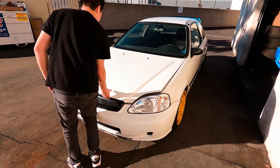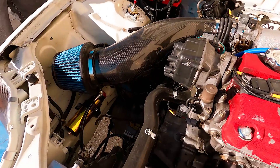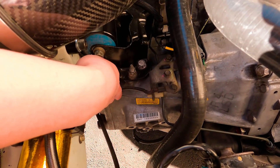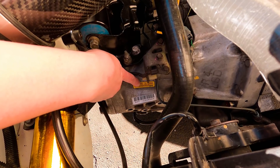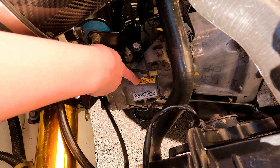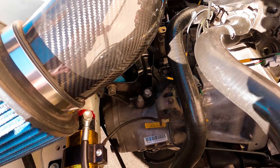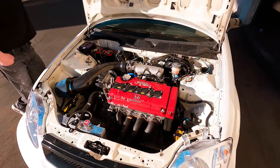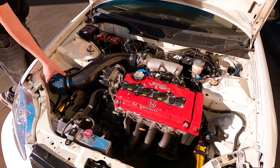They said it was a B16B CTR motor from HMO, and it came mated with a transmission. You can see the sticker right there — it says Orange Ball. So it's got a 98-spec first gear, fifth and final drive, which is a 4.785 final drive. The diff is just standard. How crazy that it has an Orange Ball transmission. Orange Ball is a tuning shop in Japan — they've built some pretty sick cars. We got to see some of their cars that attacked last year.